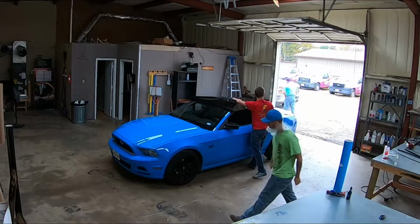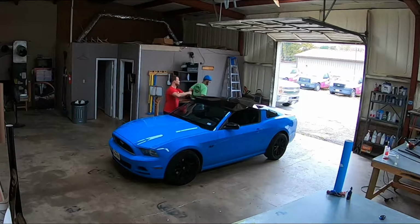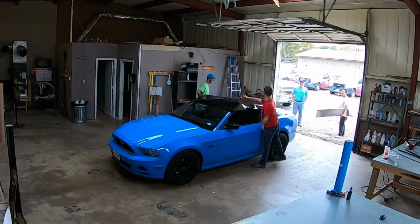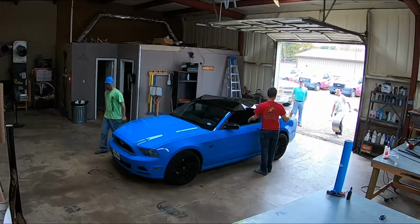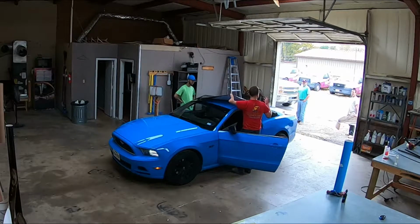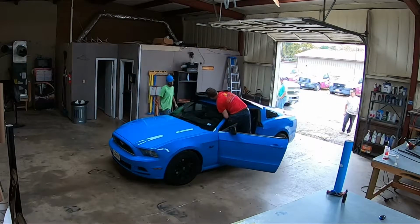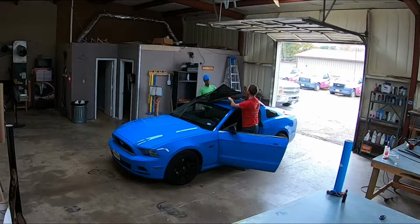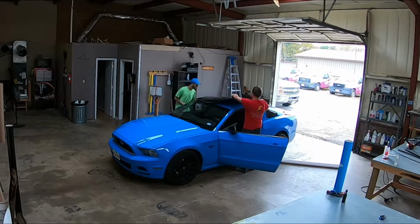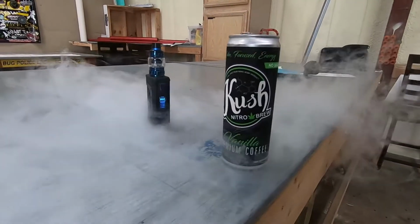As for actually laying the vinyl, I can't give too many tips. It really just comes with experience and learning how the vinyl moves. We're cold stretching it, which is better for the vinyl and doesn't stretch it unevenly. It makes it stretch in a very even fashion. But you can heat stretch it with a heat gun, which will make it to where you can get the wrinkles and everything out easier.